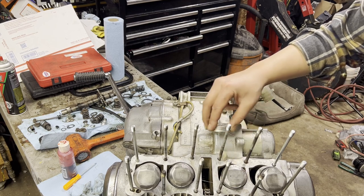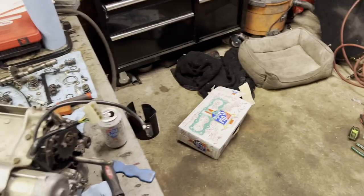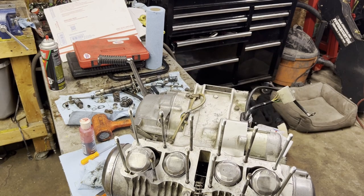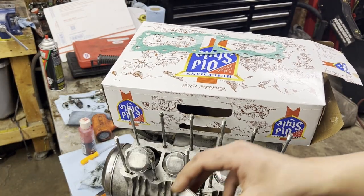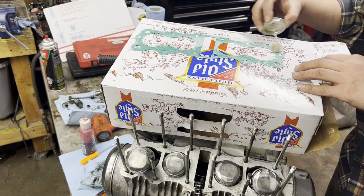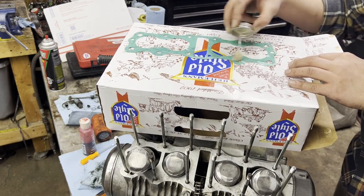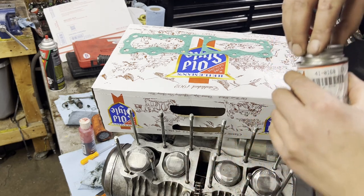Good thing that's glued and stuck. This will hold the gasket in place exactly where we want it. A couple more quick little spots to hit. This gasket's soaking it up pretty well, so we're going to do this as a nice little barrier layer. Not as thick as a silicone or copper coat would be, but we'll ensure a good gasket mating surface seal. The cases on this are actually in really good shape - no big gouges or anything like that. Now she's glued.